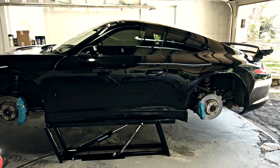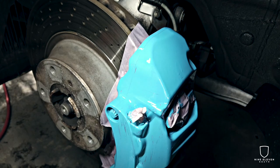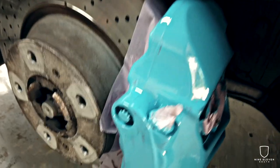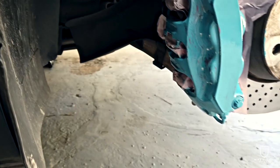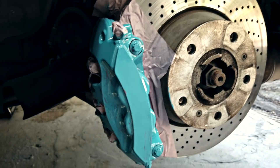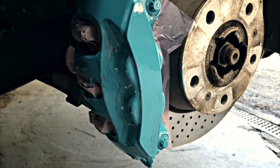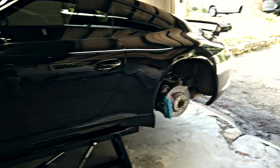With the color-matched seat belts, I think this is going to be very nice with the black. The G2 is pretty straightforward — it's sort of idiot-proof. Here's an idea of what you get with a first coat: pretty decent coverage. There will be some spots where old color is showing through — don't worry about that. The number one thing you could do to mess this up is go too fast and use too much. The only thing you really want to avoid is runs and drip marks, so go slow. You can always do three coats, and this stuff is self-leveling — it goes on liquid and really starts to level out and get very even. We're going to let this dry about 15 minutes, then hop back in for a second coat and see if we need a third.